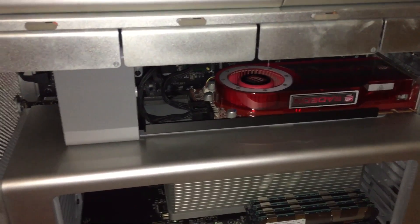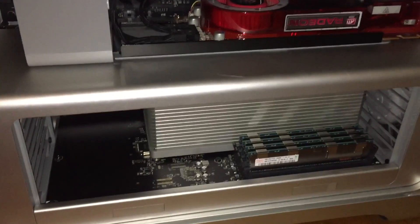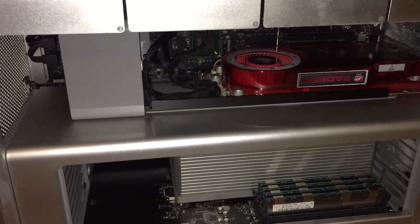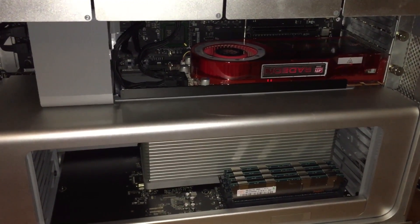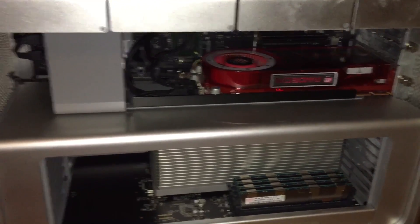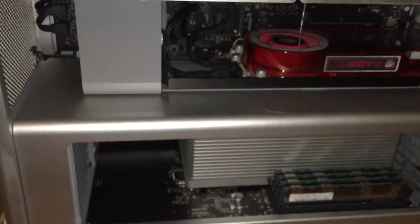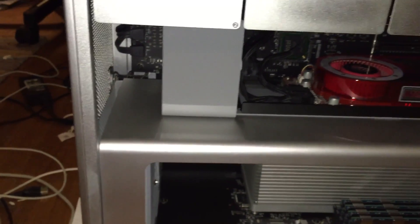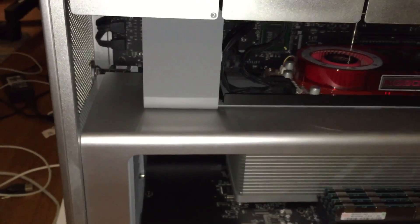This machine does have quite a strange intermittent issue — it actually seems to work perfectly fine most of the time. What happens is sometimes, usually after the machine has been turned on for a while, it will just randomly shut off or just will not turn on when you plug it in. There are some red lights right under there, and sometimes when you plug it in after it's been on for a while, those lights will just stay red instead of flashing like they're supposed to. The machine will not power on unless you let it sit for about 30 minutes and then it starts working again.